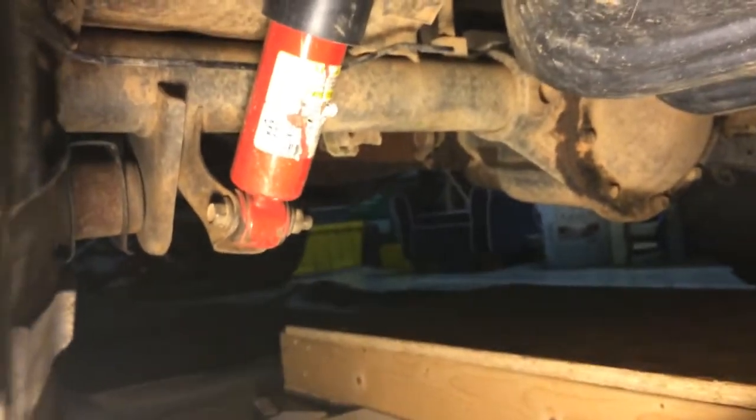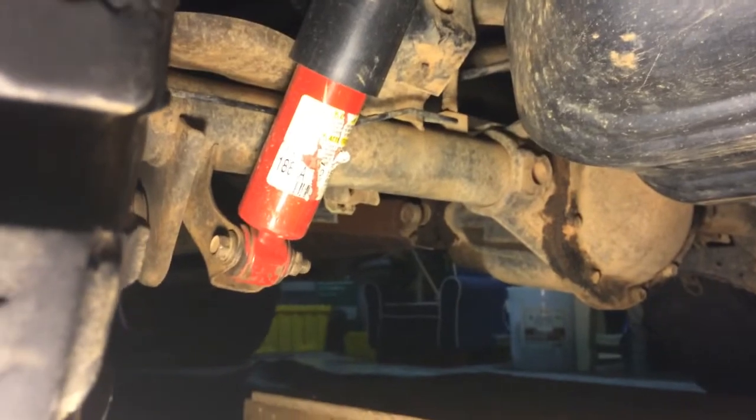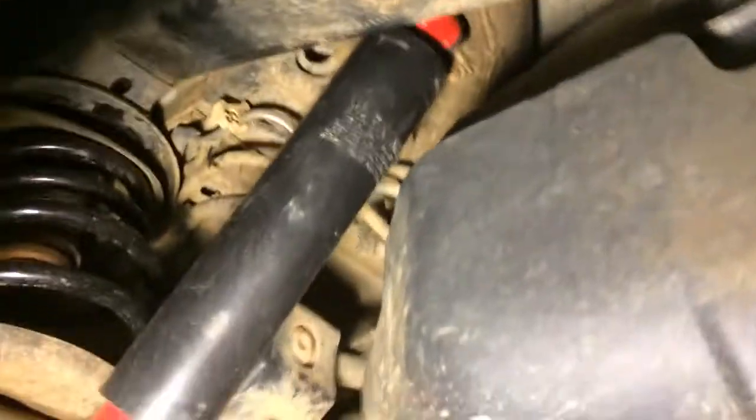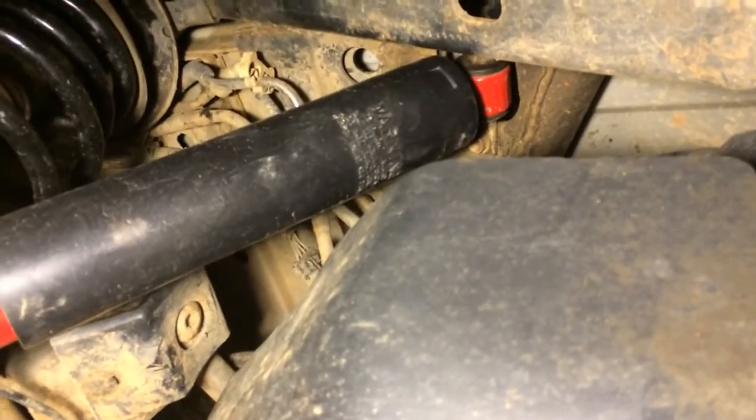It's actually about a week later. I went ahead and installed the Rubicon shocks and I wanted to show you what the scoop was on this. On the JK shocks, the lower eyelet is actually a hair wider than the TJ's eyelet — therefore it's a little bit too wide for this bracket. There are two ways to handle this: some people like to just stretch the bracket out a little bit wider and cram it in there, which is viable. The other option is to tap the eyelet a couple times with a grinder and narrow it down, so that's what I ended up doing. I did a test fit, ground, test fit, ground a couple times, and it slid right in. The top half of the shock mounts just into the factory location with the factory bolts — no big deal at all. I think some people do a bar pin eliminator up top, but I did not elect to do that.